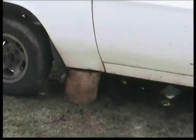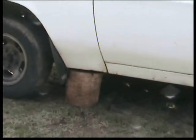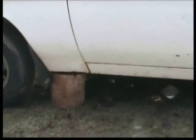It's always a good idea to put some chocks under the back wheels to stop it moving. You can see here I've just put a couple of metal chocks in front and behind the rear wheels just to stop it rolling. Then I've jacked up the car with a couple of red gum blocks under the front of the chassis rails on both sides — they're only about a foot high just to give us a bit of access under there to drop the tail shaft and the extractors.